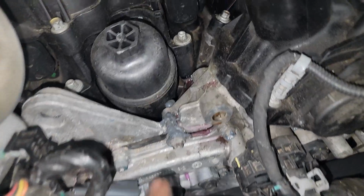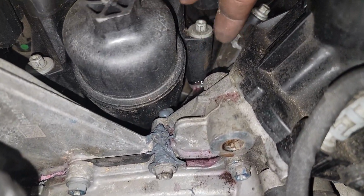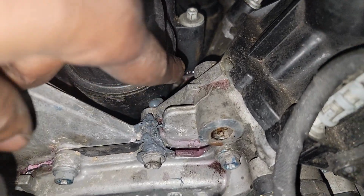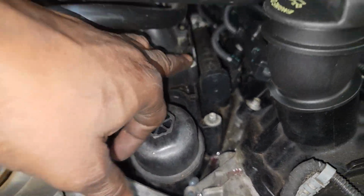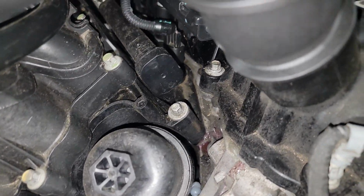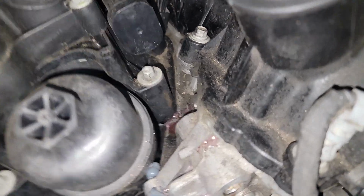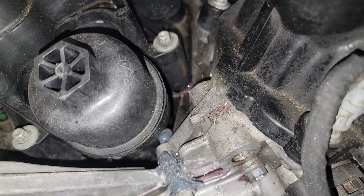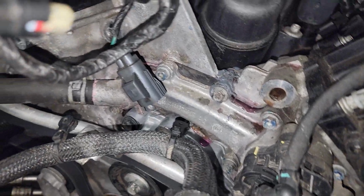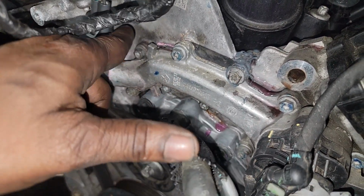This is a hack. But why have I got coolant down here on this? There's no coolant going through this intake. So maybe it's coming through here and falling down there. There's nothing in this intake but air. It's not a coolant jacket, in other words. And then the head gasket is a lot lower. I don't know where the hell it's leaking from. Oh my goodness. Guys, we may have to pull this aluminum Dorman.